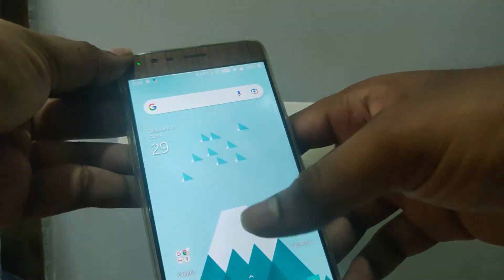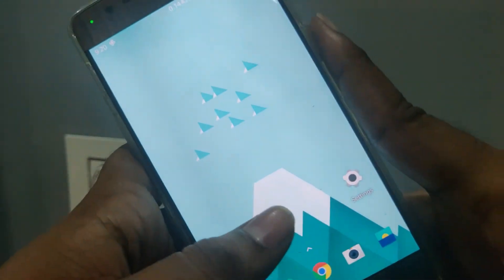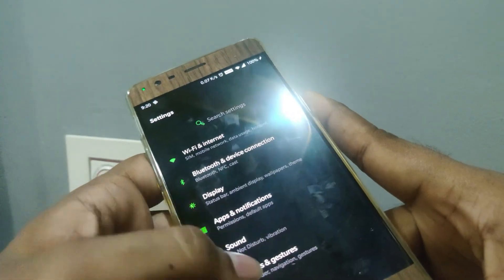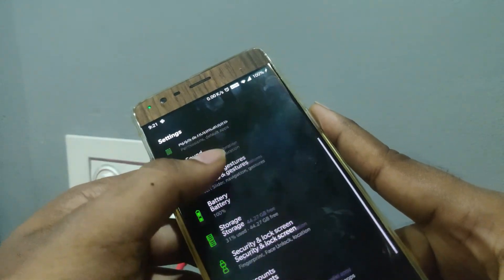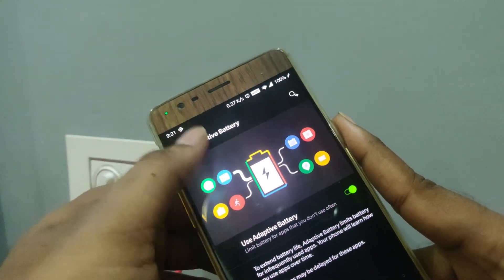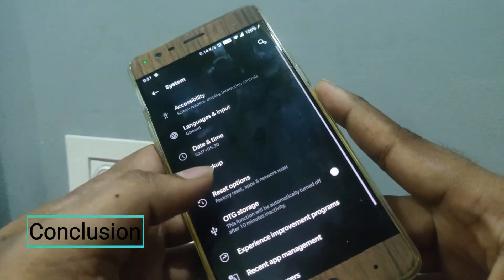You may wonder what happens if you charge the mobile even after it reaches 100%. In that case the charger is no longer charging the battery — it is powering the phone, and when the charge drops the charger kicks in to complete it back to 100%. Batteries last longest when kept between 40% and 80%. Charging to 100% shortens the battery's longevity due to charge cycles — for a number of cycles, the battery loses its efficiency. That's why companies ship mobiles at 60% charge, to reduce cycles and help longevity. I do not suggest leaving your mobile for overnight charging — there's usually no risk, but any small defect inside the battery due to water, dust, shock, thermal resistance, or overheating can lead to a risk of fire and explosion.